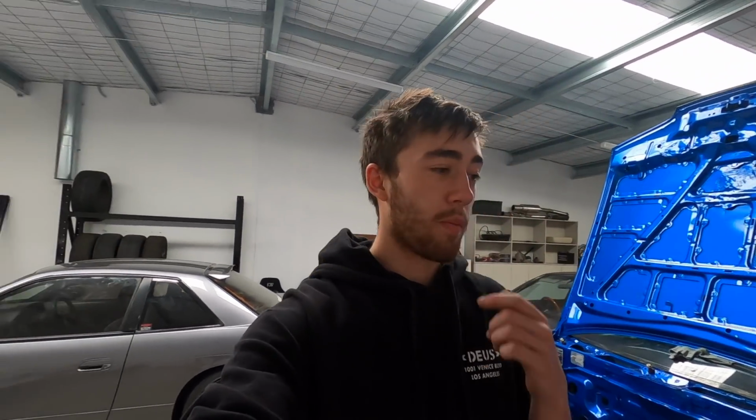So remember a while ago in the video where we had a look at the gaps in the rings to see if we were going to need to file them or not. I didn't read it properly, and I actually got them back to front. I thought it was 23 thou on the top and 19 thou on the second row, but thank you to Zach Sawyer for pointing out that that was incorrect, and luckily he did, because if we had gapped them back to front, that would have been a giant waste of time.